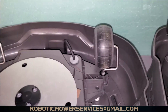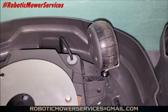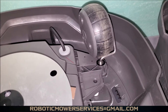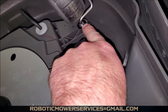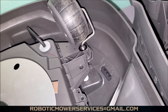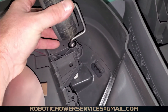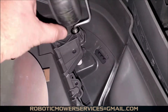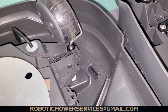If you've ever tried to remove the front caster wheel assembly — the entire assembly, the whole axle and everything — on a 300, 400, or 500 series rear-wheel-drive Automower, you know it's a bit of a process. You have to actually split the upper and lower chassis apart to get in there, take the push nut off the other end of the axle inside the chassis. Even if the wheel just fell out, to get it back together you have to split the chassis apart and put that push nut back on. It's a time-consuming process.